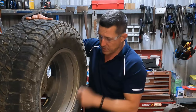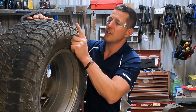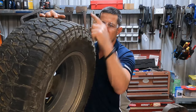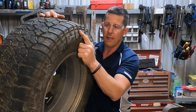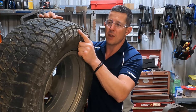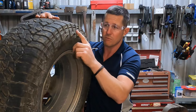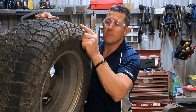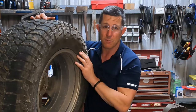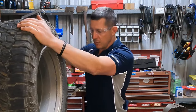I've pumped this up since, just gently, and I'm pretty confident this is the only leak. But you can see it's not on the tread part of the tyre — it's on the wall of the tyre. So that may not be the best repair. We probably need a new tyre because it can propagate and the tyre will fail. But for this purpose, I think there's enough rubber there for it to get us out of trouble as an emergency spare.